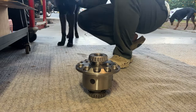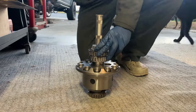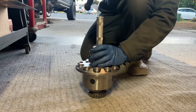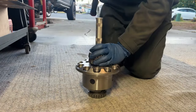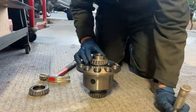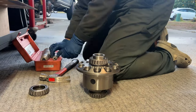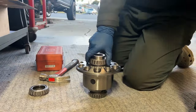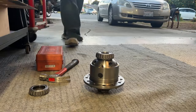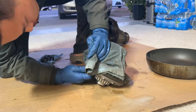What's up guys, xxpocketknife here. In today's video we're going to be installing the air locker in my uncle's first gen Sequoia. The first step is removing the old carrier bearings from the old carrier. The new ARB carrier and locker is a stripped carrier — no ring gear — so you have to reinstall those by taking them off the old one.